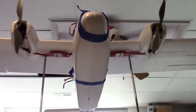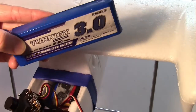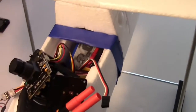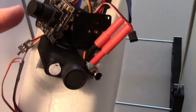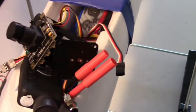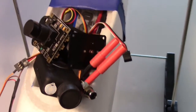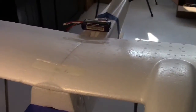Now we're going to try some different batteries. The first battery I'm trying is a 3 amp 4-cell lipo — you can see it down in there in the fuselage. I've got my video equipment piled up here: a couple of cameras and my pan tilt just for weight. That battery works pretty good but I still had to add a little weight to the rear just to keep it balanced.